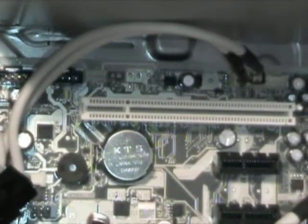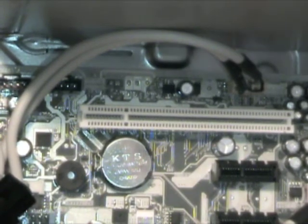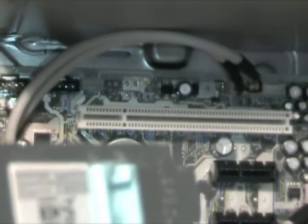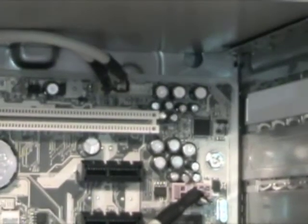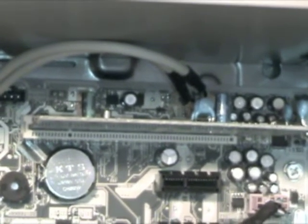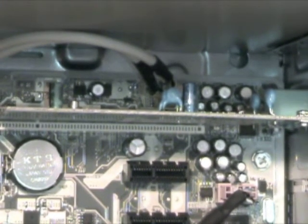So you can just go in and snap this thing where it goes and it won't take but a couple of minutes. Let's go ahead and put this PCI card in. The way you put it in is this outside here, where the phone cable in this case is going to be plugged in, has to go in that direction because that's the opening. So we just basically snap it in, make sure it fits, don't force anything, and it's just going to snap in. The gaps within the PCI card just have to align with the slot and it'll snap in. If you're not aligned correctly it's not going to go in, and you don't want to force anything because you're going to break it and you're going to end up buying a new card.